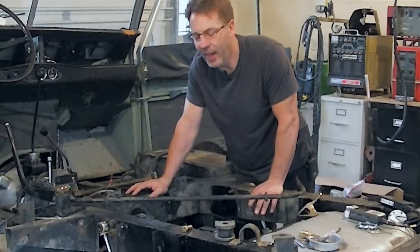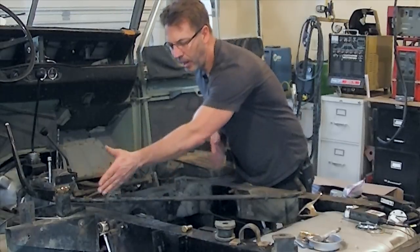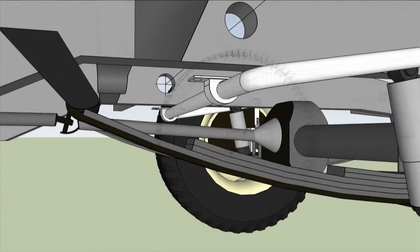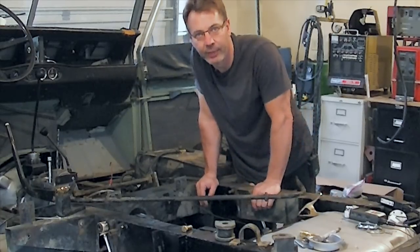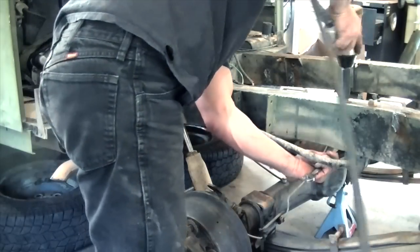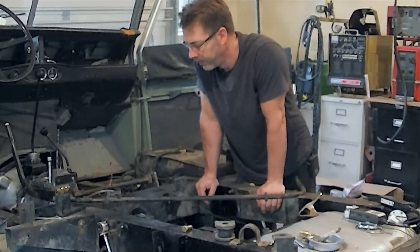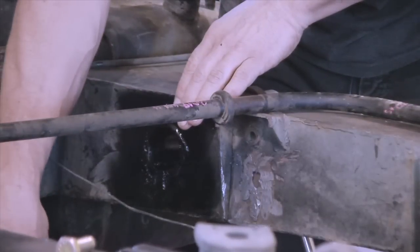Now, one thing you need to realize is that this is not an easy project, the way I'm installing it. I'm installing it on this side where, if I were to bolt it straight up to the frame, the propeller shaft at certain times will bounce and hit up against it. Originally when I had this installed, I had it on the other side where the gas tank is now, and that's a quick installation — takes about two hours. You can use a sway bar off a classic Land Rover, and every time I've been to the junkyard there seems to always be one there, selling for about 15 to 20 bucks. But in this situation, this sway bar has to be put up high enough so it doesn't interfere with the propeller shaft.